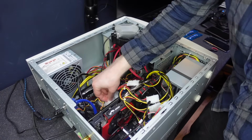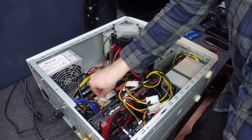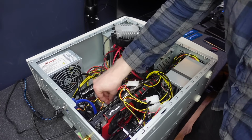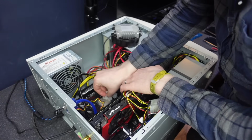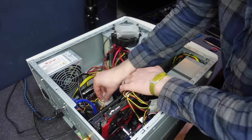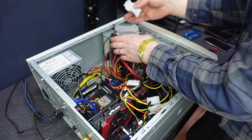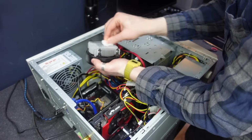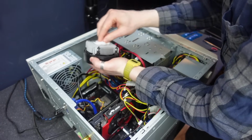I'm not looking for squeaky clean. Just going to do a fresh application of thermal paste, reapply the cooler, see if we can clear that error. Could just be a weird BIOS thing, who knows? I know you guys can't fully see, but this has definitely turned into one of those ramble fest type videos that you would probably have on in the background whilst doing something else, because I'm just here seemingly for hours now trying to solve what's going on with this system.